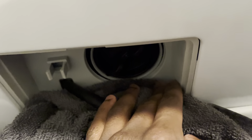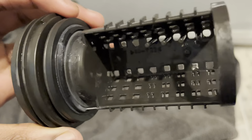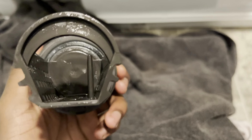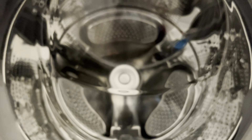What you want to do is go to the drain pump. The first thing you want to do is let all the water drain out first before slowly opening the filter. Once again, I'm doing this so that it is easy for you to solve the OE error. If there's any lint stuck inside the drain pump filter, remove any excessive lint and any item — for example, a penny that might have fallen in the tub.